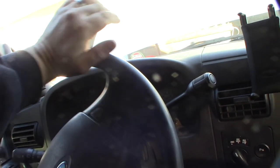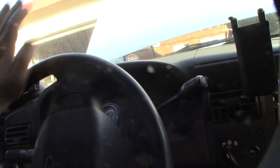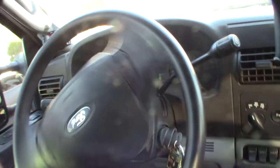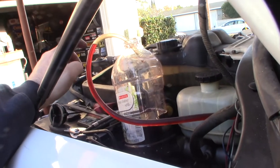You can see it popping out. As soon as I start seeing clear new pink stuff coming through — and it already looks like it's starting to come through cleaner and cleaner. I'm pumping the brakes back and forth, and you also want to turn your steering wheel all the way, because you're actually draining the piston inside the power steering pump. So you want to do the steering and the brakes back and forth.